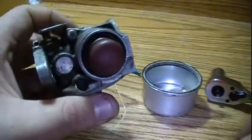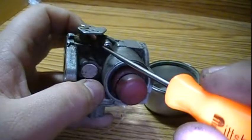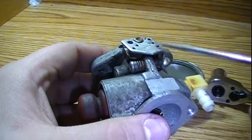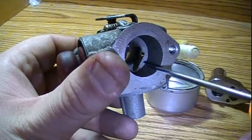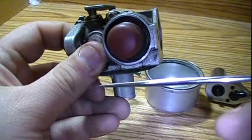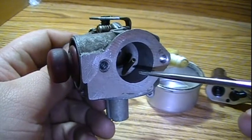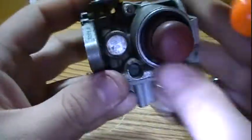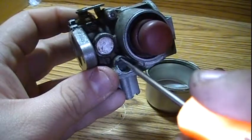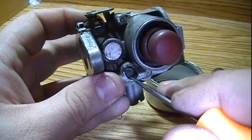Other parts on the carburetor: we've got the butterfly valve, which controls the fuel and the airflow. We have the engine speed control screw, which opens or closes the throttle mechanism. The venturi is smaller, to allow atomized fuel and air to enter the engine via low-pressure vacuum. The primer sucks in air and forces fuel in through the passageways on the carburetor, to allow fresh fuel to enter the engine to ease starting, since these carburetors don't have a choke. This here is another jet, which doesn't really do anything — it's just another passageway in the carburetor with no adjustments.